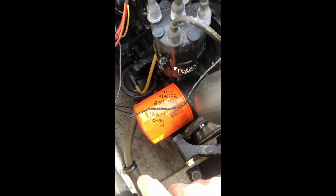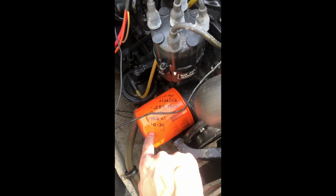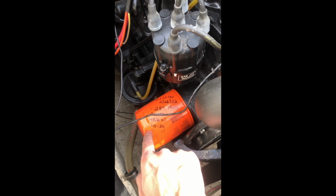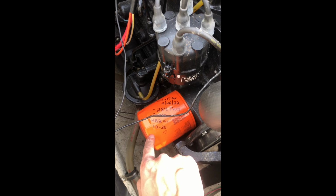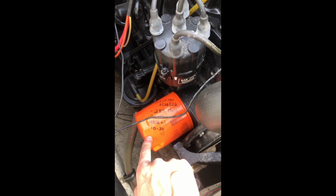As a reminder, when you're adding a brand new oil filter, you're going to want to substitute the amount of oil that would be in the oil filter. I suspect it to be just about half a quart, so I'm going to add a total of 4 1/2 quarts to this 3.0 liter engine.